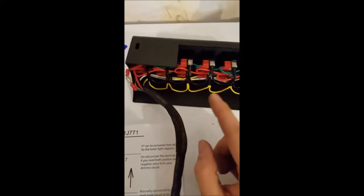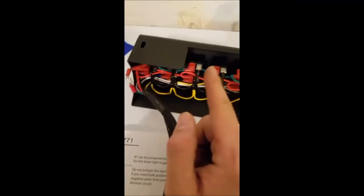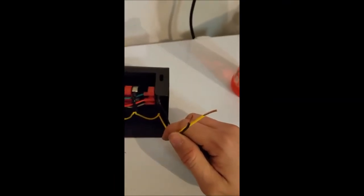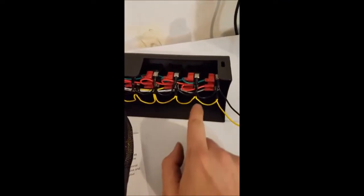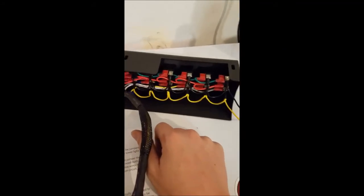Although this plug is for the actual switch panel itself, everything else is going to work the same. I tried to tap into the green wire before with the orange wire with the gray stripe, only to find out that the green line is just the ground — so I had to tape that up and solidify it. Aside from that, this is going to work just like before, except now the lower LED is going to be powered from the yellow wire. I had tapped that on the Jeep from the orange wire with the gray stripe — that wire is now up by the windshield. I'm going to do a butt connection there, run a ground from it down through the A-pillar, and tap on somewhere by the footwell since there are plenty of grounds there. Then you can bend those connections down to make sure it fits up against the header.